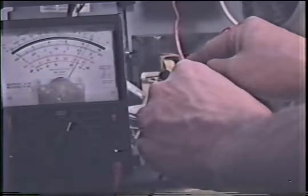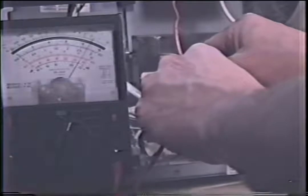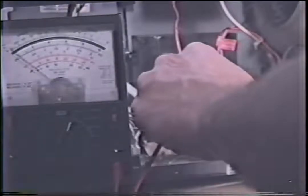Now let's look at the third high voltage part. What I'm going to do is basically ohm out the windings. Let's start with the primary windings. Pull the wire. I should get a reading here, and I do. Now some schematics will show what resistance the ohms reading that you should have. This schematic doesn't on this microwave. So basically what I'm looking for is just some continuity. The primary windings should not be grounded. So that's open. Windings are closed. That checks out.